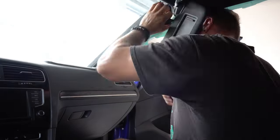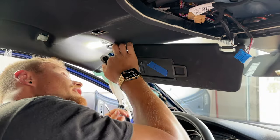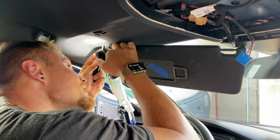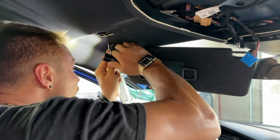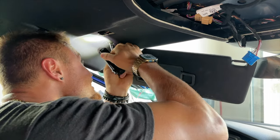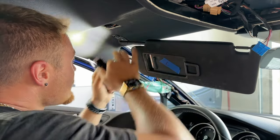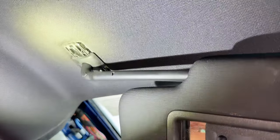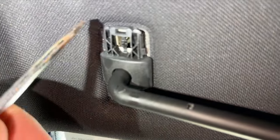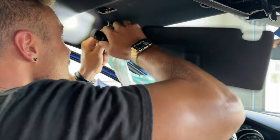Moving on to the sun visors — these use the same clips as the handles. I had to remove the A-pillar in order to access the top of the headliner, which was hiding the disconnect clip that held the sun visor on. I couldn't really find any tutorials on how to remove this, so I was just playing with it. They're similar clips where if you bend them with a screwdriver you can shimmy them free. This clip is horizontal and this one is diagonal but all the way inside, so with a flathead screwdriver you can get in and shimmy it — no special tools really required.